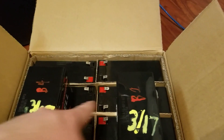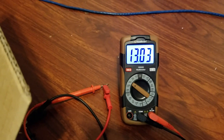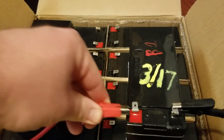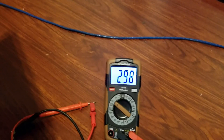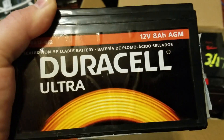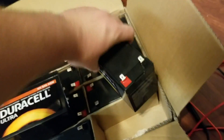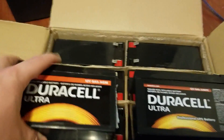There were a number I was able to salvage. This one came out of the same string — B4 and B1 were on the same string but three batteries apart, so this one was salvageable. It's at 13-point-something volts, so still good. This other one is at 2.98 — about three volts — so that one is toast. I'll salvage the good battery for maybe another project, maybe some solar stuff.